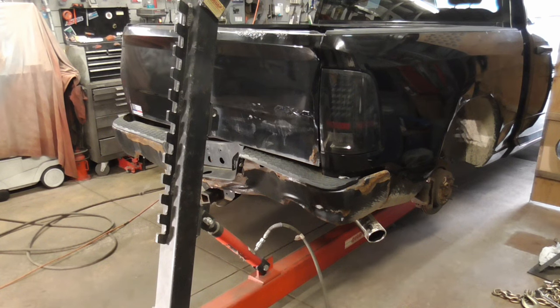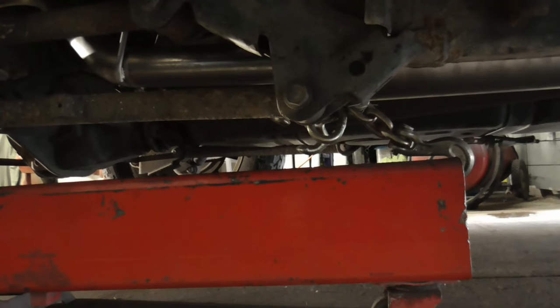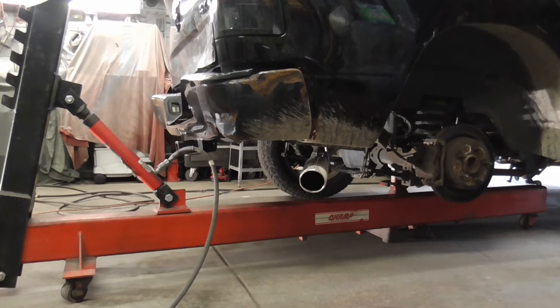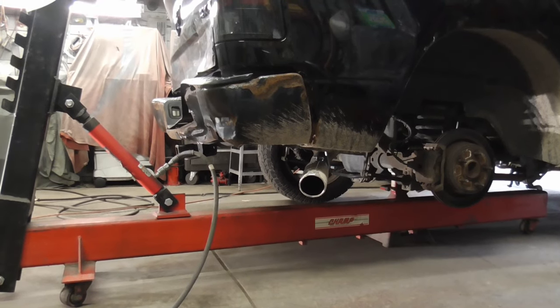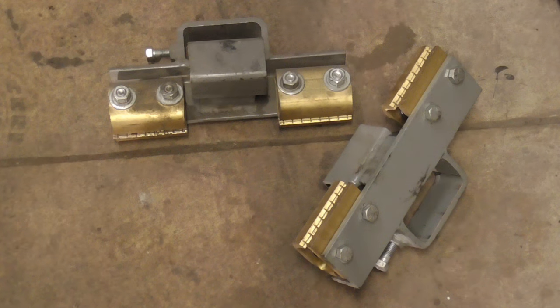The frame rail is bent on this truck, so today we're going to use a dozer type frame machine to pull some of the damage. Here's how the front of that frame machine is hooked up — one hook to the end and another hook in a hole in the frame. With this type of frame machine on full frame vehicles, you don't need the pinch weld clamps. You can just hook the front to the frame and pull from the back. For unibody cars, pinch weld clamps are needed. For full frame vehicles, you can just anchor the frame machine to the frame of the vehicle. I'll post the instructions to this frame machine in the description.